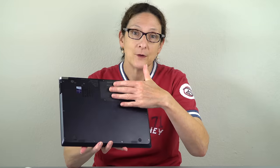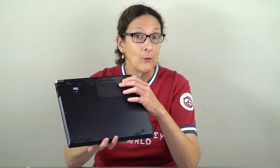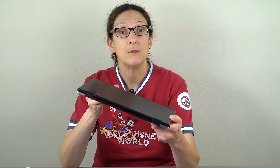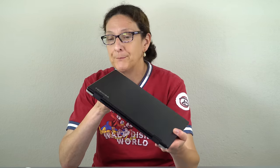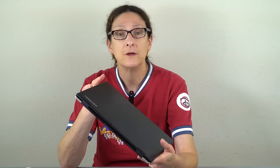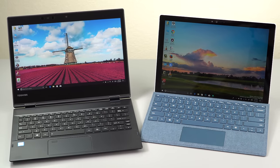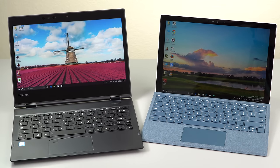Full Intel Core i5-7200U, i7-7500U, and i7-7600U CPUs are available, all with Intel HD 620 integrated graphics and a single fan design that exhausts out the side. There's a CPU hotspot warning label on the bottom. The fans might seem concerning for something this thin running full 15-watt Kaby Lake 7th-gen dual-core CPUs — no wimpy Core M here. The first couple of days during setup I heard the fan; it's audible but not room-filling. After setup I really didn't hear it again — not playing casual games, not using Photoshop. Heat is also manageable, which is an impressive engineering accomplishment compared to the Surface Pro 4, which could sometimes sound like a vacuum cleaner and get very hot.